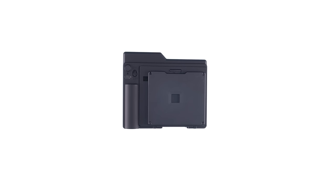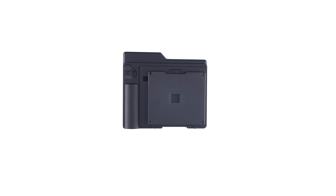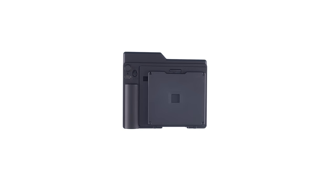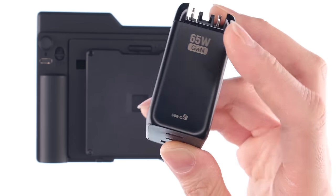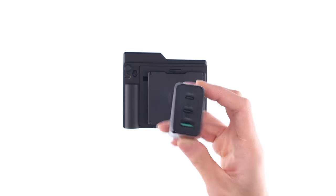Next is the battery. This uses a non-user-replaceable rechargeable battery. In the short term it works great — I shot two packs on a single charge with no problem. My issue is I hate batteries; they are a guaranteed point of failure in any system, and when they do fail, I'd like to be able to replace them easily. I just wish it had used replaceable batteries like all the other Instax cameras. On the topic of the battery, this charges through a USB-C port, which I'm grateful for, but it can't charge with USB Power Delivery — it won't charge through USB-C ports, but it will charge through a USB-A port. It's not that big of a deal, but it's a little annoying.